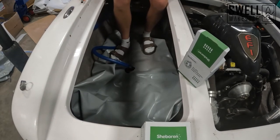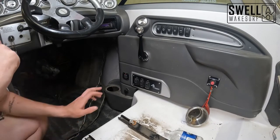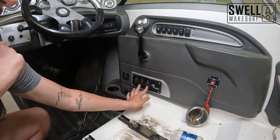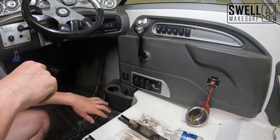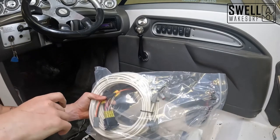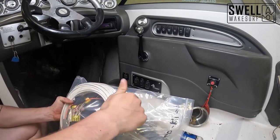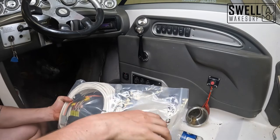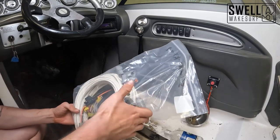This rear locker bag is all wrapped up. We'll do the same thing to the other side and then be done with the plumbing back here. We have all three pumps mounted and we're going to work on the wiring. We're going to use the same panel they had here prior since it has front left and right positions. We'll just remove it — we have three wiring kits that include a wire running back to the pumps and a wire running to the fuse block at the battery, plus the switches.